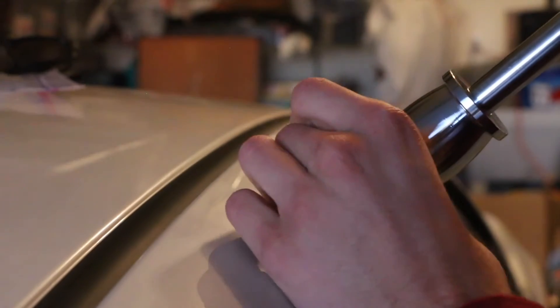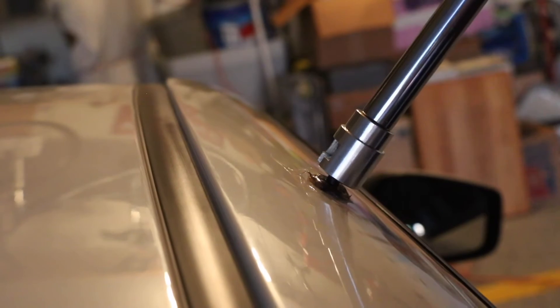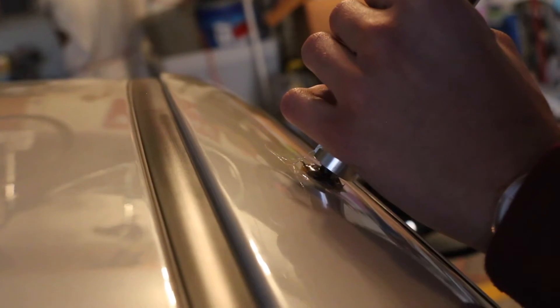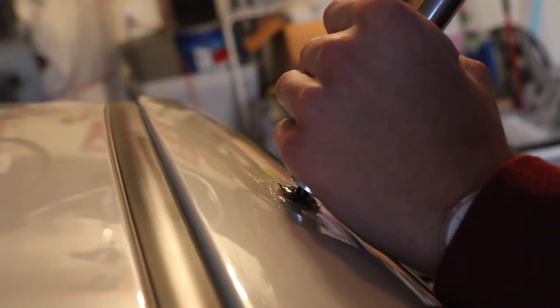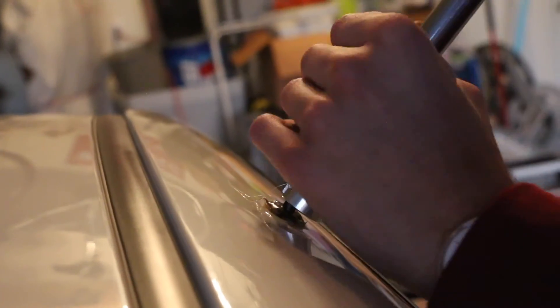The glue actually stopped. Okay, so now I'm gonna use the weight of this mechanism to kind of pull it. And eventually it's gonna come off. Now if it comes off the first time, it may not pull the dent out. So you might have to do it a couple times. Make sure it's all tightened. The dent is still there. So we're gonna try it one more time.